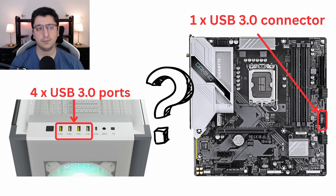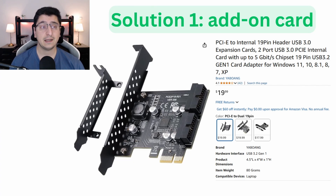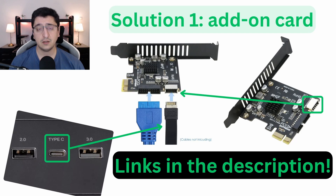So what do we do if we already bought all the parts for our system? Well, let me show you a few ideas that will save you time, money, and headaches. First, we can add an add-on card to one of our PCIe slots. This card can be plugged into one of the motherboard's PCIe slots and allows us to plug not just one but two extra cables, which in theory can give you up to six USB 3.0 ports. There are a ton of variations for those add-on cards — links will be in the description box below. Some of them even come with a front Type-C connector in case you need that as well.